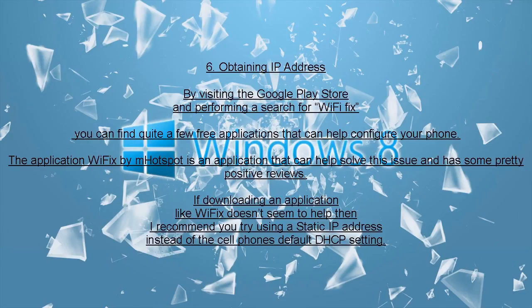6. Obtaining IP address. By visiting the Google Play Store and performing a search for Wi-Fi fix, you can find quite a few free applications that can help configure your phone. The application Wi-Fix by mHotspot is an application that can help solve this issue and has some pretty positive reviews. If downloading an application like Wi-Fix doesn't seem to help, then I recommend you try using a static IP address instead of the cell phone's default DHCP setting.